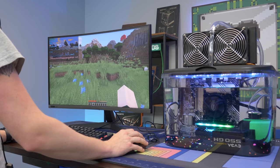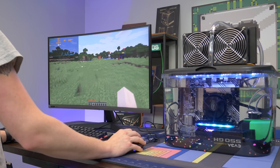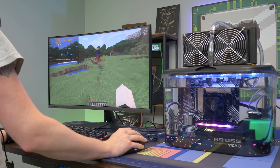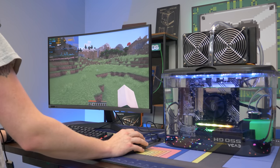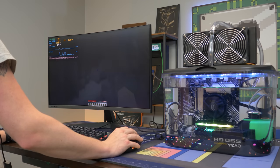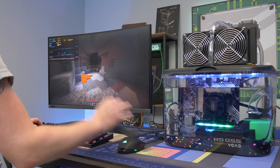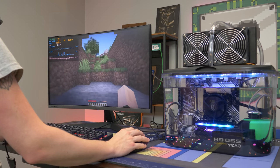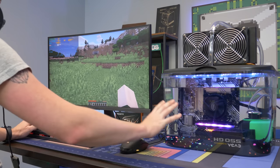Temperatures are getting a little hot but not that bad — we're fluctuating a lot, going between 50 and 60 and back down to 51, so these might not be the most accurate readings. We just don't want to see the CPU go above about 90°C. The computer has been running for over an hour downloading stuff. Mineral oil takes on the ambient temperature — our office is around 71°F. The oil starts at a pretty low temp and you need the system running at max load for about 30 minutes for the heat to spread throughout the oil. You can feel the oil is just slightly warm.